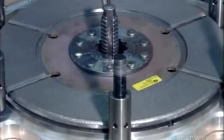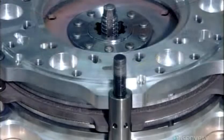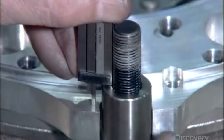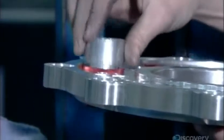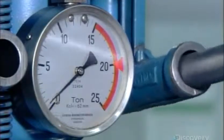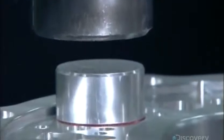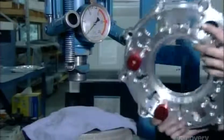The technician places a stand over each bolt, then arranges the clutch discs and a floater plate on the flywheel. He presets the height of the stands, then prepares the pressure plate assembly. He presses aluminum cups into holes in the cover. These cups will hold springs that will be used to change the pressure of the clutch pack.